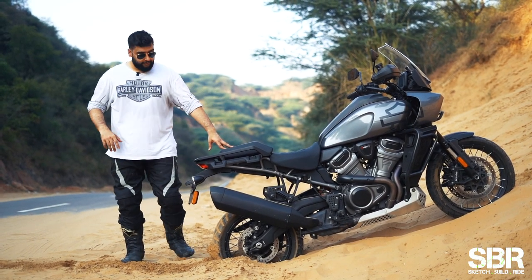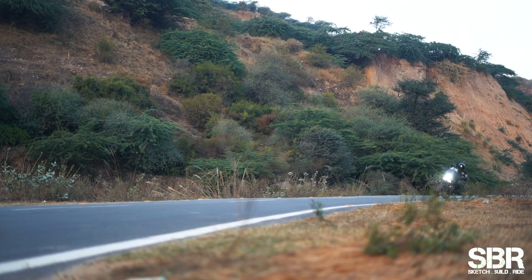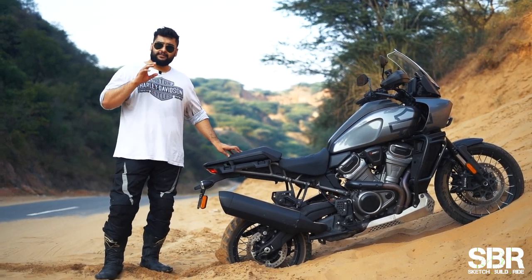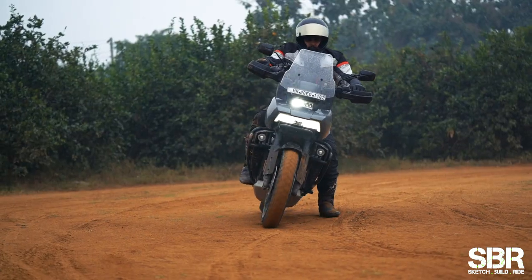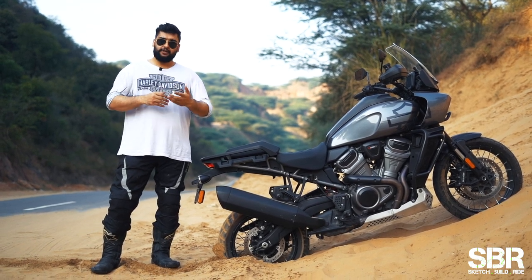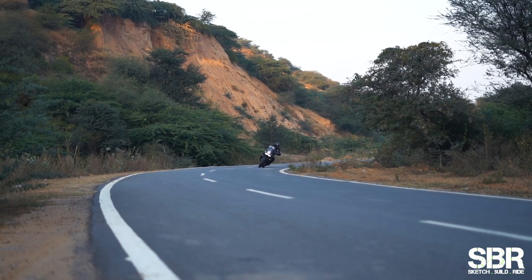One of my favorite things about the Harley Davidson Pan America is the handling. The rake on the motorcycle is nice and sharp, so you turn into corners pretty nicely, and it holds onto the lines very well. It requires some skill because it's quite heavy at 240 kilos plus, and the seat is pretty high. But the mass has been kept in a very smart way — the battery and everything else is down low, keeping the center of gravity low even with the V-twin cylinders up top. What you get is an amazing handling package in twisties and off-road alike.